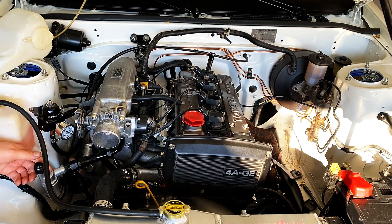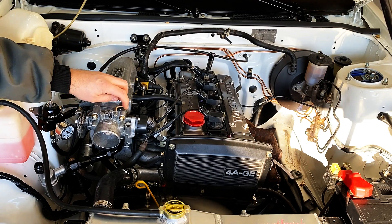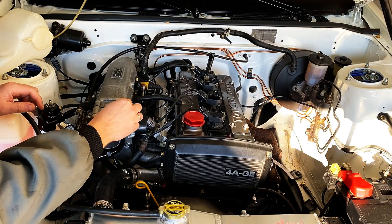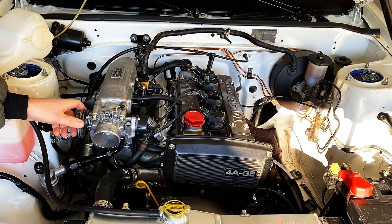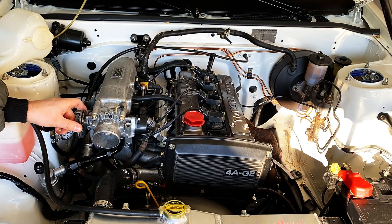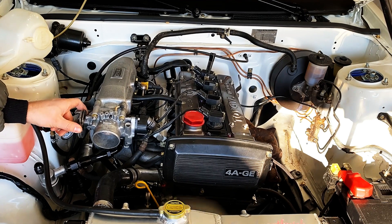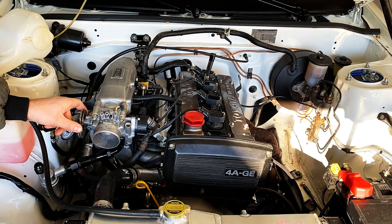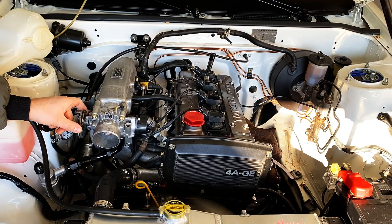Here I'm playing around with the engine idle, playing around with this engine switch, because the stock AE86 throttle body has its own unique system, but I'm not a big fan of it, so I binned it and made my own. It turns out I'm not so smart after all, because the valve I used was from a much larger engine, so the default idle setting is way too much for this little engine. With this switch it idles at about 2000 RPM, so I ended up plugging the hole. It has a side bleed manual control valve that I just set to about 800 RPM — that's the way it runs now.